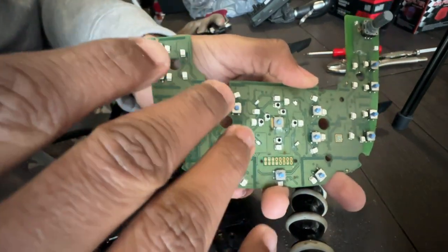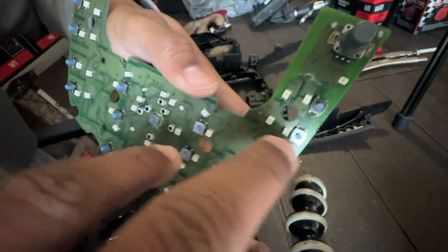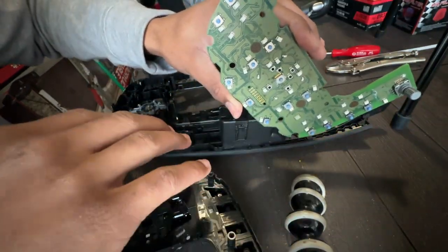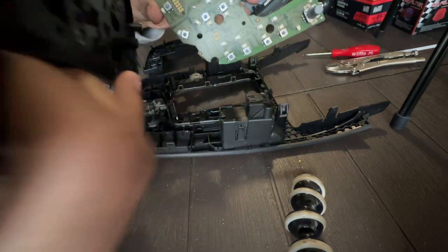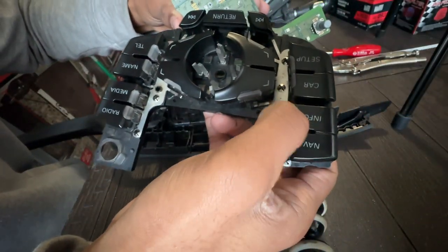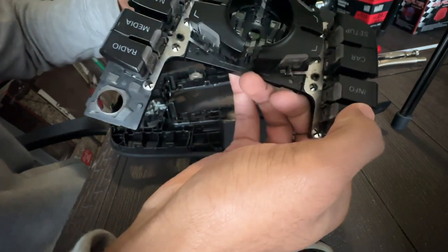This is the circuit board right here. It looks clean from a glance, but if you get a little bit closer you can see some syrup around the power button and also a couple other areas on the board itself. What we're going to do for both of these parts is take some alcohol and a Q-tip and go across the board. These buttons pop off pretty easily, so we're going to pop those off — same process, Q-tip and alcohol — and see if we can clean these up, because they are super super sticky.